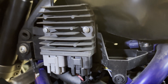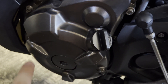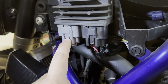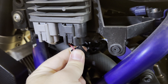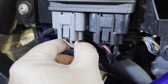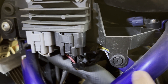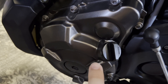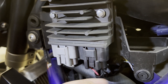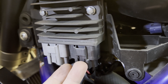This item right here is our regulator rectifier. Essentially what's happening is while the motorcycle is running, the stator has magnets on a rotor and they're producing an electrical charge, then sending it up the wires to the regulator rectifier. The gray plug here is the one coming directly from the stator. The three-wire connector is the dead giveaway that it's from your stator because it is a three-phase system. The two-wire connector is positive and negative from the regulator rectifier, and this is what's sending voltage back to the battery. Current comes out of your stator as AC voltage, goes up to the regulator rectifier which converts it from AC to DC voltage, and then sends the DC voltage to your battery to keep it maintained.